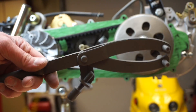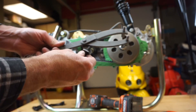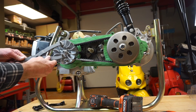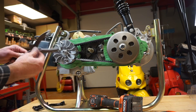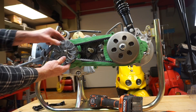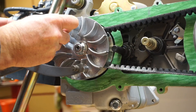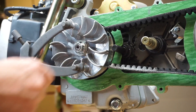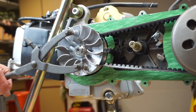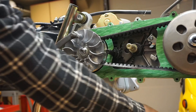It's always a good idea to have one of these tools — this is a variator tool or a clutch tool, used for either. You stick it down in there and then you can hold the assembly while you loosen that nut.